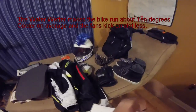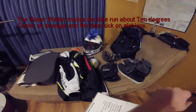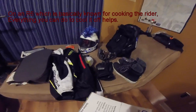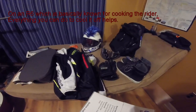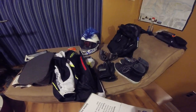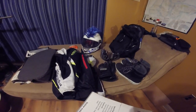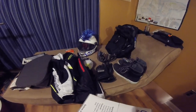I just got back after changing my coolant to water wetter. I went for a ride around the city for a few hours to see if the water wetter did anything. I do think it's cooler riding around slightly — I noticed my fans don't kick on as much as before with the stock 50/50 antifreeze and water. I swapped it out for distilled water and water wetter and I think it runs probably 8 to 10 degrees cooler when you're doing stop-and-go like in traffic or neighborhoods. I do notice the fans kick on slightly less.